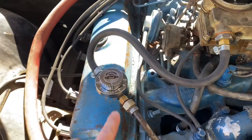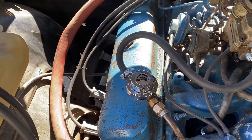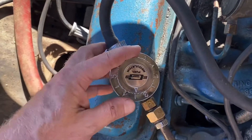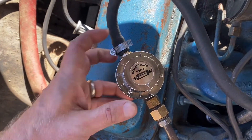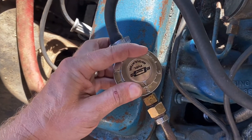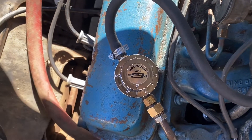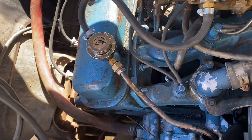What I did is I went out to the parts store and got an adjustable fuel pressure regulator. You can pick these up online or at almost any parts store. It's 1 to 5 pounds. All you have to do is push down and turn — there's 3 pounds, push down and turn — there's 3 and a half pounds. It's pretty simple. As soon as I did that, I haven't had a problem with it flooding.